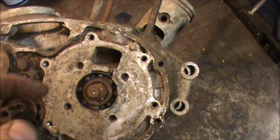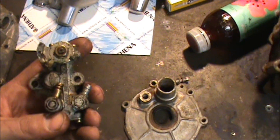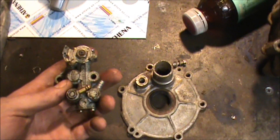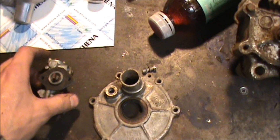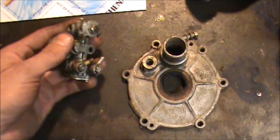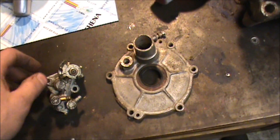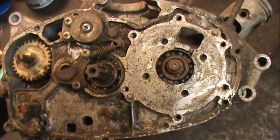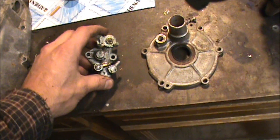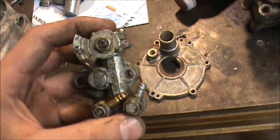You're getting your air, fuel, and oil mixture all mixed precisely going into the cylinder. As long as these oil injection pumps are working, you're getting a lot more precise mixture at various speeds than if you mix your gas and oil separately in the fuel tank. A lot of people have different opinions about them — if it's got it and it's working, I use it. Sometimes people will take them off, and that can actually affect another tube that feeds your crank bearings — and your crank bearings will go out and need to be replaced. So usually if they have them, it's good to take them apart, clean them, and keep them working.